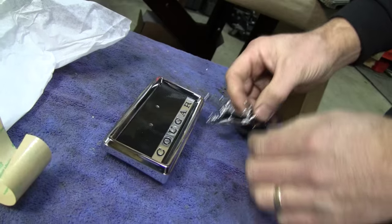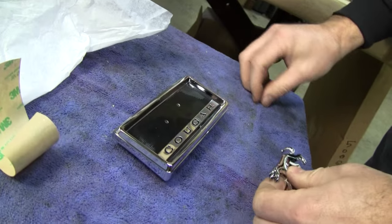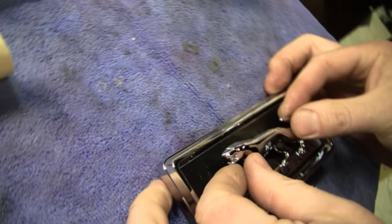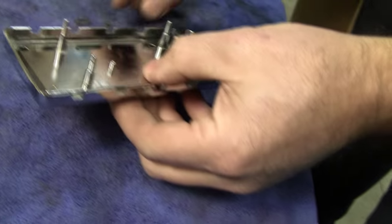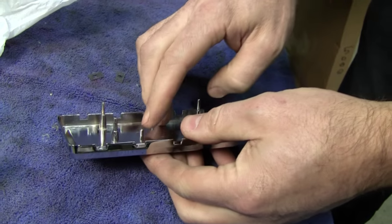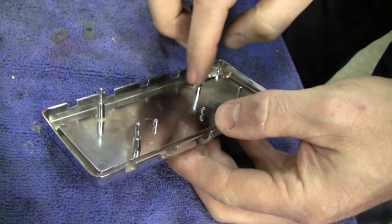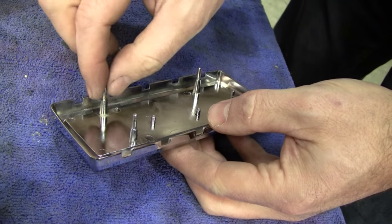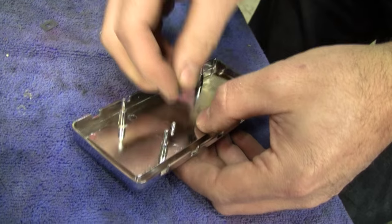And if all is well, this kitty, which also has two little clips as seen here, is going to go right in here. Bingo! Perfect. Okay, let's put our kitty on. Now if you're reusing yours, you're going to have ground off these studs off the backside because they're peened over, and you're going to use epoxy to put these back in. Same with this. You're going to have broke off these studs, and now you're going to put them back on with epoxy.